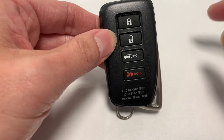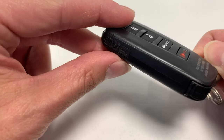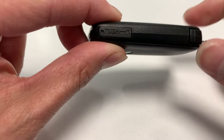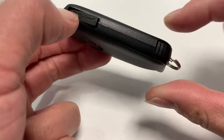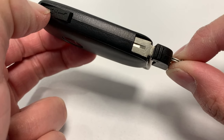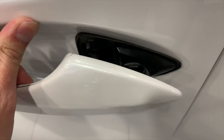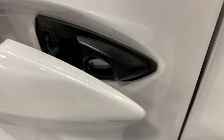If you are out of battery, the door will remain locked when you close your finger to the handle. In this case, you will need to use the spare key. On the side of the Lexus key, you will find a push button — just slightly push the edge and pull the spare key out. Then pull the driver's side door handle, insert and turn the spare key from the bottom to unlock the door.